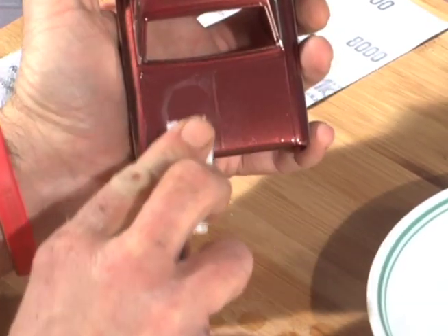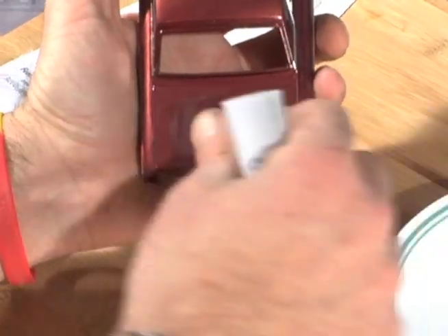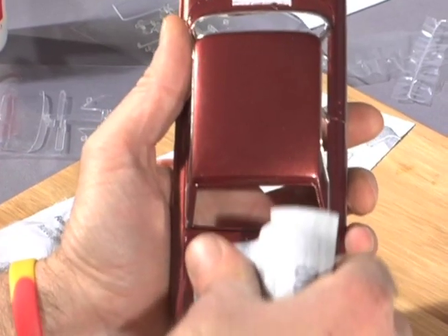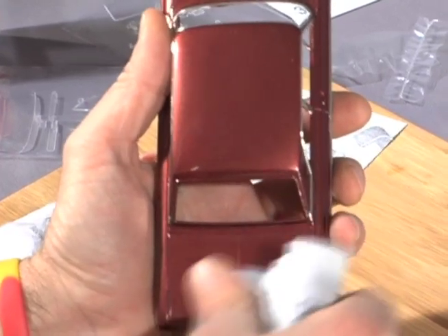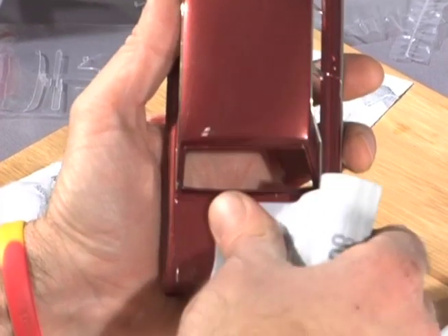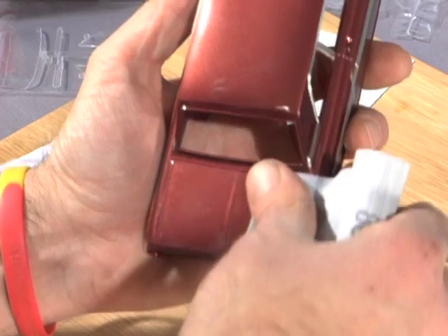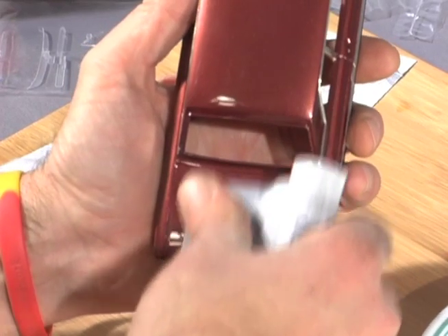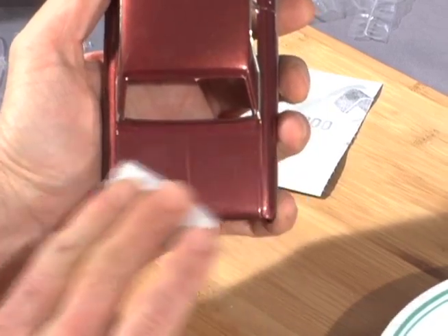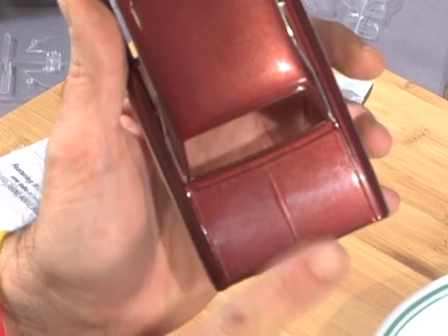Now as you can see, that real heavy look is starting to disappear. We're going to walk up to the 8000 and get a little motion going — you want to try and sand the whole thing so everything is uniform. Always check your sandpaper. Being that this is a brand new kit I don't have to worry about it, but always make sure you don't have any grit or dirt on it. Protect this sandpaper like it's your baby sister — keep it in a zip-lock bag when not in use so dirt and dust can't get on it. Make sure you rinse it off real good with cold water before use. Okay, the 8000 is done — we've got a little bit of milkiness, but the shine is starting to come back in.